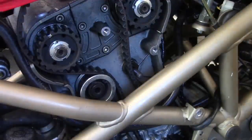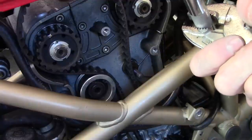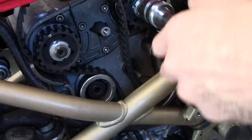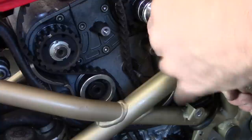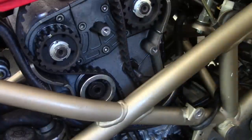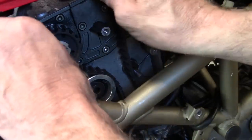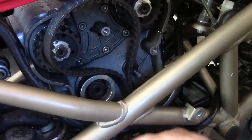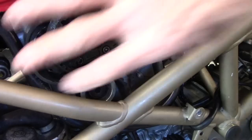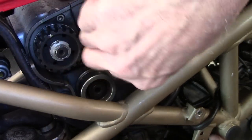I've got my Honda tool here — the one I built for the Honda CB750 clutch. I know it fits because I checked. It will jump off from that lobe — you can see it's a little bit spring loaded; there's a small spring that keeps tension on everything. So now we can slide this belt out.